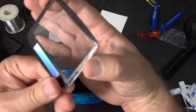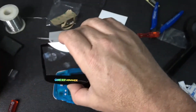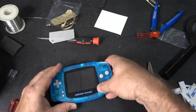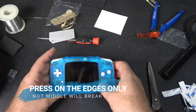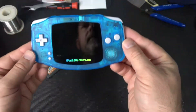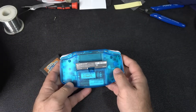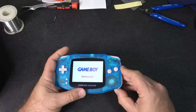I fingerprinted it on the outside, which I couldn't tell at first — but it cleaned up. This is glass, so remember: only press the edges. Pressing the center will crack it — you are stronger than the glass. Press the edges only. Don't worry about fingerprints on the outside because they clean up easily. We now have a working Game Boy Advance. Look at the screen on this — in my opinion, absolutely beautiful.